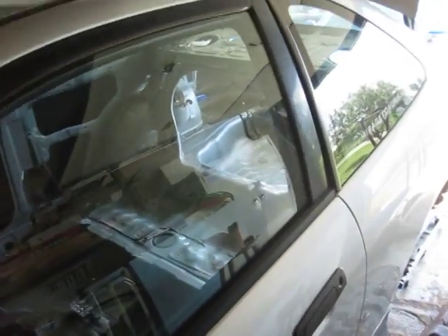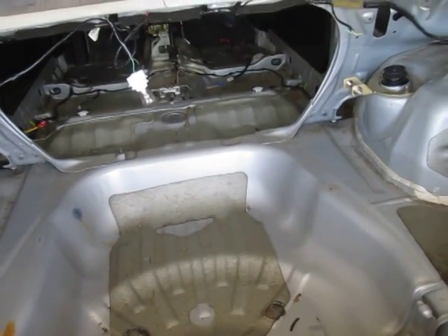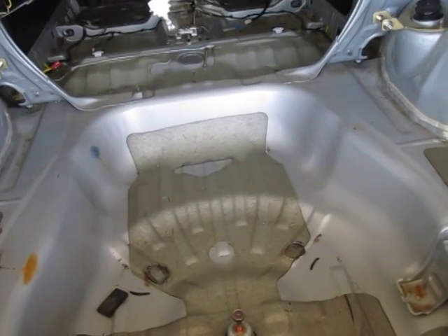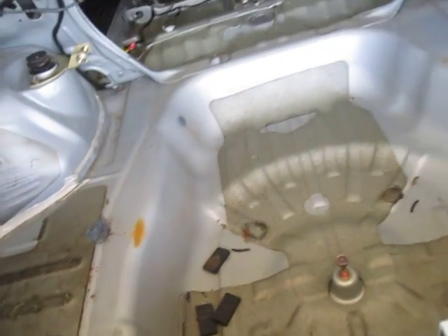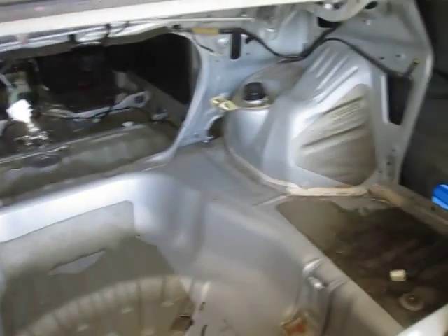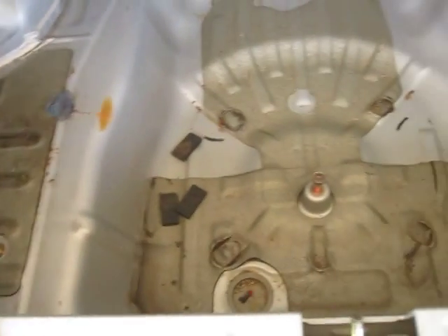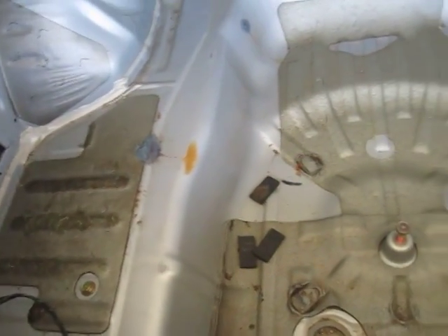Right now my complete focus is on getting this floor pan changed out. If I can get started drilling on it this weekend, I'll be pretty happy with that. It really shouldn't take a whole lot of time to get the floor pan out once the car is stripped down to it. Once we get that far we'll be in pretty good shape — only a handful of rust repairs before the new pan can go in. Doing all the spot welds should only take two or three days. I'm planning to probably paint the trunk with old-school speckle paint — I'm kind of a muscle car guy and I think it would be neat to have speckle paint in an EVO.